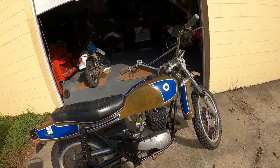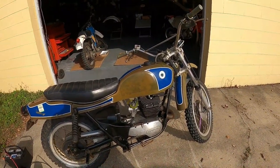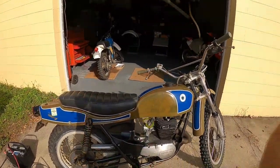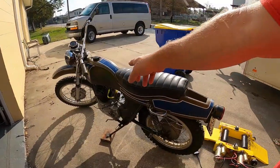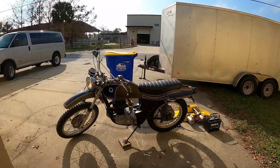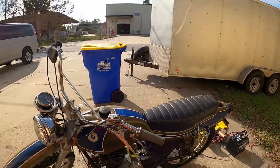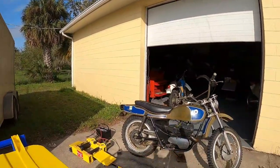You could go out and smoke a cigarette and it would still be holding six pounds. Got a hundred and forty pounds plus compression. I have spark. I triple-checked my timing. Spark was a little bit iffy, so I took the red coil off and stole my PVL coil off the Hercules, so I got nice fat spark. I disconnected the ignition switch and the kill button and got nothing. So now we're gonna get serious.